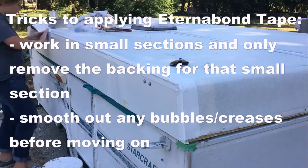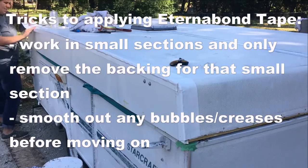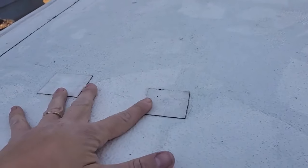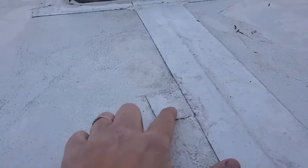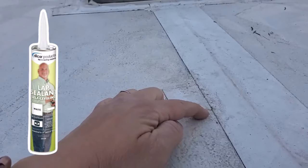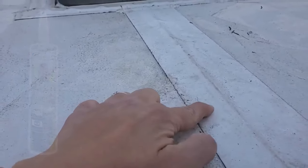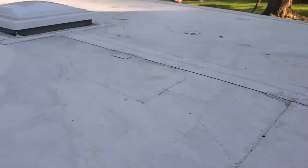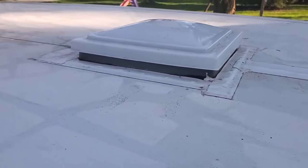Make sure you're not puncturing the tape in any way when applying pressure — you can also use the palm of your hand, just press pretty hard to make sure it is adhered well. Eternabond tape works perfectly to seal up holes and cracks. The edges are secure and there's no water getting past this tape. The trick with Eternabond tape is when you need to overlap it at a corner joint, it's super important that you use something like Dicor lap sealant at those corners. If you don't, water can slowly seep in through those edges and down underneath the tape, messing up its integrity and ultimately getting into your camper roof. This is the biggest mistake I've seen made on plenty of YouTube videos and on a camper I purchased where someone had put Eternabond tape around their roof vent. I also decided to put Eternabond tape on all of my roof edges, going under the trim — an added measure that may not be necessary, but I wanted to make sure there was no more water getting into that roof.